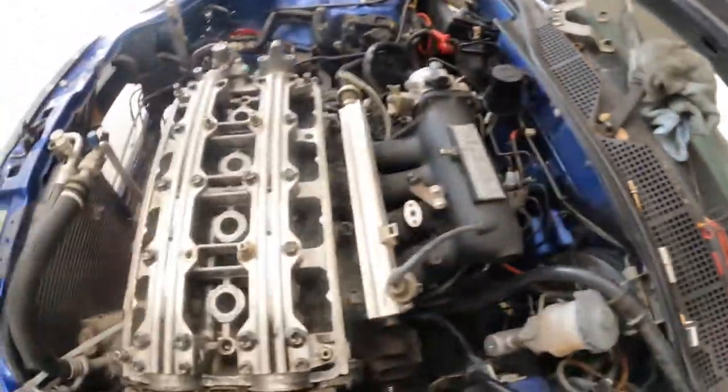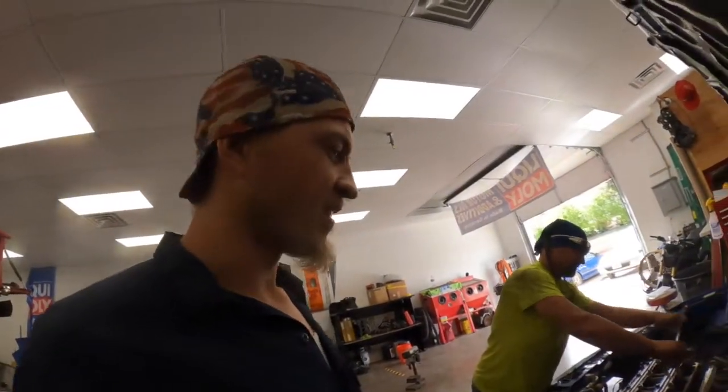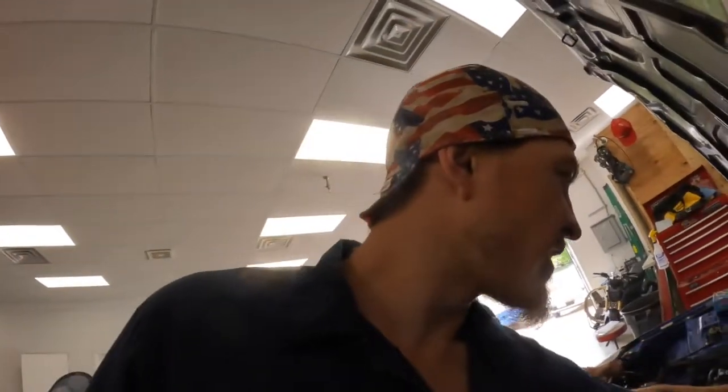He says — did it break off? Showing off. Sure it did. This is what happens when you tighten them too tight. That one is down in there. Good thing we've got head studs — wait, that's not a head stud, that's a cam cap bolt. And these are aftermarket ones — Skunk2s. They got tightened too tight, didn't even get torqued. Every job is one broken bolt away from being a two-day job. That one is actually down in the head. Hopefully it's flat with the top — it's going to be a weld-and-extract situation. We'll weld her and get her out. If not, we've got another head.